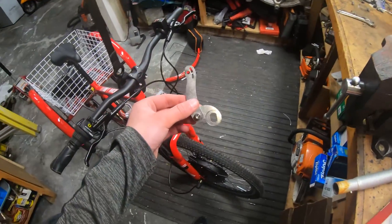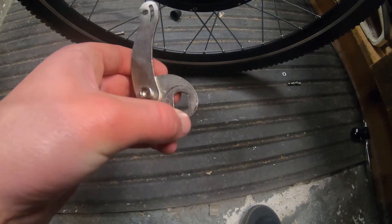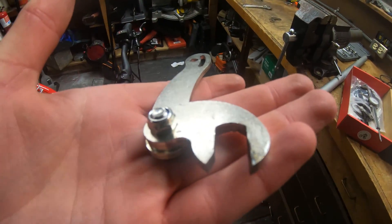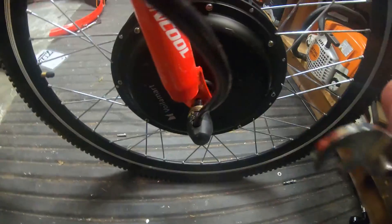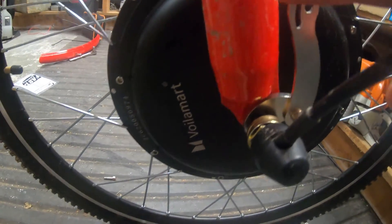One thing about putting on your torque arms: on the right side of the bike you have this wire coming out of the wheel, and you obviously can't slip the torque arm over it. You really want to use both torque arms, so what you're going to do is cut out this bottom section right here — the bottom section is going to be a lot easier — so that it'll just slip right over. Here's the finished product with that bottom section cut out. The purpose of the torque arm is to keep this axle from twisting, and it's still doing its job because it's got these flat edges right here. Slip this on right over here, then take your hose clamp and put it on around this fork.